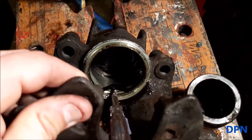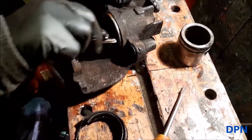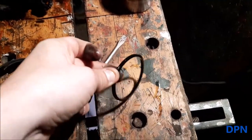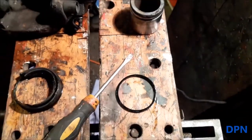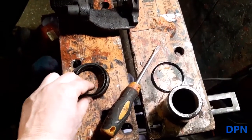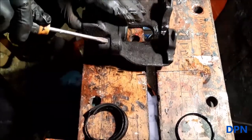The seal is going around that outer edge — you can just about see the little black rim all the way around. We prize it out. It's hard to tell whether it's worn but the new seal will certainly be better. Both seals are now out — the outer seal was certainly stuck on there tough. We now need to remove the two little rubber guides for the slider pins.